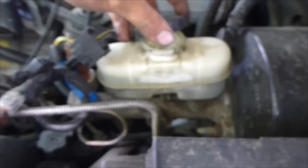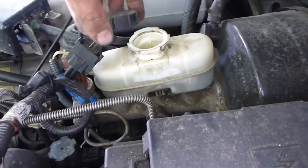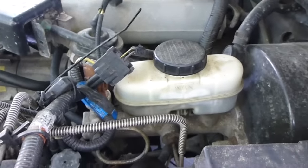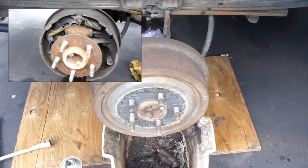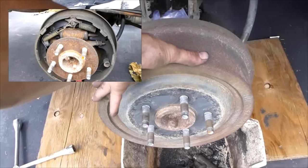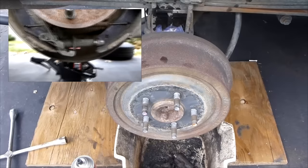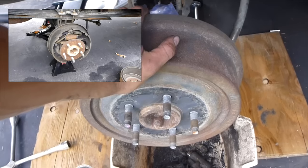And the next thing you're going to want to do is top this off. You can see that it's relatively low. You just want to get it to that max line. And make sure you use your correct brake fluid. This is DOT 3. Just check your owner's manual. And you're done. So if you watch the video that I have a link to in the description, how to change the drum and shoes, plus this video on how to change the wheel cylinder, you just did a whole brake rebuild. So now your rear brakes are going to be good for years to come.